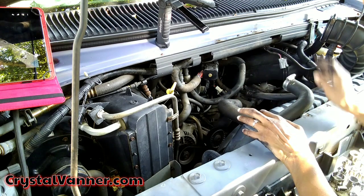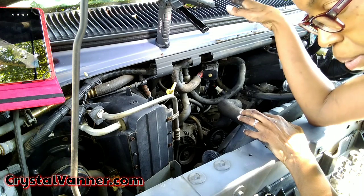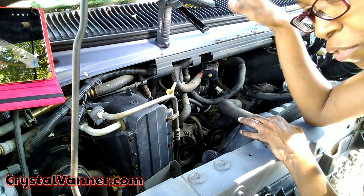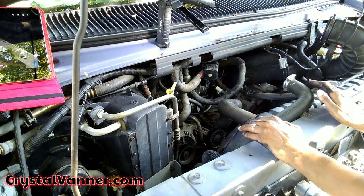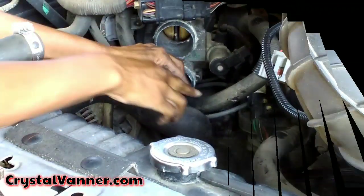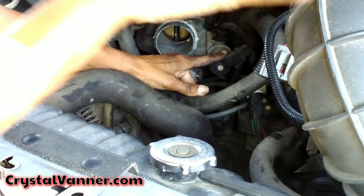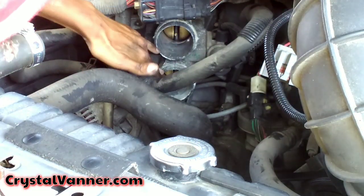It took me an hour. I even went inside and removed the doghouse to find it because I thought maybe mine isn't accessible from the front. My whole front of the van is a mess. But I found the idle control valve — I'm going to move you guys over to this side so you can see it. This is the part I'm replacing. I couldn't see it because of this whole hose assembly I had to take off the engine.